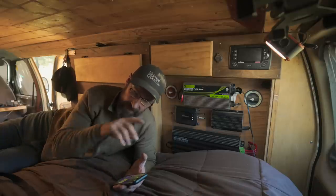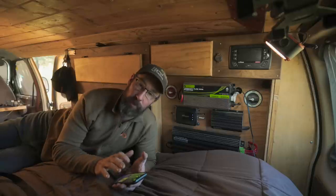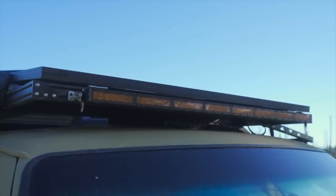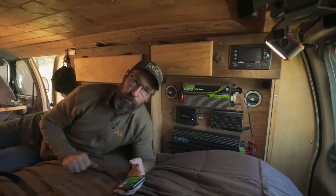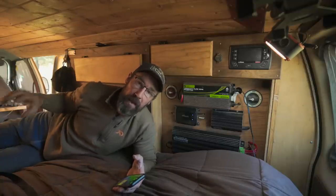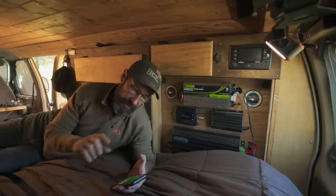The other nice thing is I can switch on devices through the system. My interior lighting can be turned on and off through my phone. I've also got my air compressor wired up to it, and all my external lighting as well. One last cool feature is you can set three triggers - basically supply a 12-volt source to those trigger points. For example, I have my dash stereo wired so I can listen to music at camp by just turning it on through the phone. The stereo draws from the house battery, so I don't have to worry about deadening my start battery.